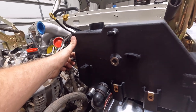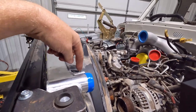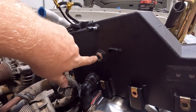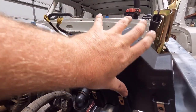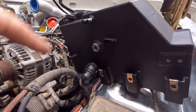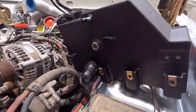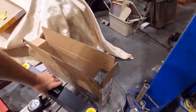This is all going to function just like it would in the Power Stroke — the vent hose to get air out of the radiator goes back up here and all that. One thing I don't like is all you have is this little sight glass to see the coolant level, where with the factory tank you have a big open area you can easily glance at. So you have to keep a closer eye on your coolant level. I also got my cooler for the secondary radiator — this is actually an oil cooler, sometimes called a universal cooler. It fit this hole just perfectly, so that's why I'm using it.